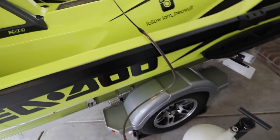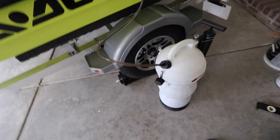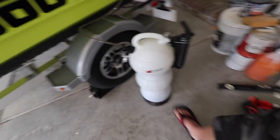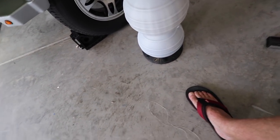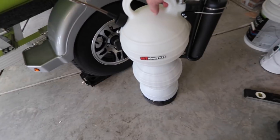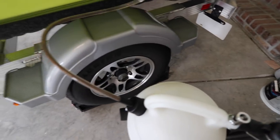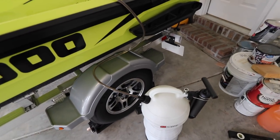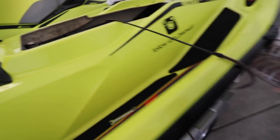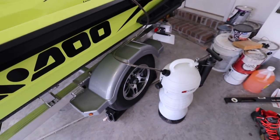Okay, you can see it's getting to the bottom of the crankcase and getting the oil out. This is like 20 minutes in and you can see at the bottom a fair amount of dirty oil — it's nearly filled one of those containers. I've kind of been pumping a little bit and letting it sit. You just don't want to fidget pulling the tube out because it's at the bottom. Do a lot of pumping and let it sit — gravity pulls it down and in.